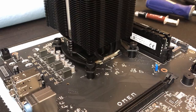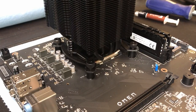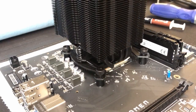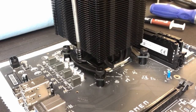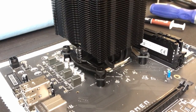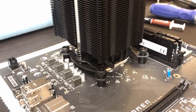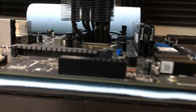I switch from the left to the right side with my long screwdriver — you can see the cooler moving just a little bit as I get it fully tightened. I do a couple of turns on each side, alternating back and forth until I'm getting close to the end of the threads on the bracket. I tighten up the right side and then the left. The install is done, though I can see the thermal paste poking over the edge a little — I likely used too much.